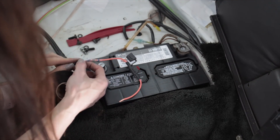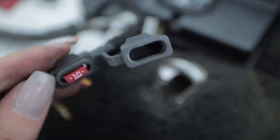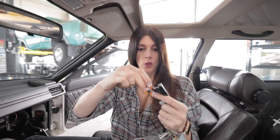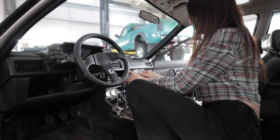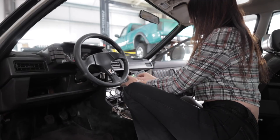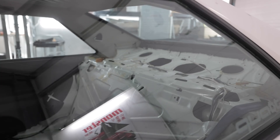Using a 10-amp fuse in this to match what the head unit is rated at. Honestly, the only thing I want to use on here is the external mic for Bluetooth for phone calls — I'm not going to use the USB, and it doesn't have steering wheel controls. Power — yay, cool, it works! Front speakers. Time to put this delicate thing back in — this is extremely nerve-wracking.